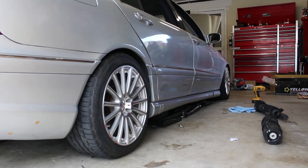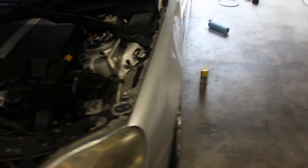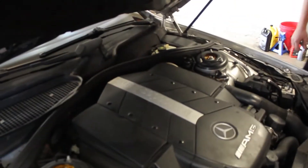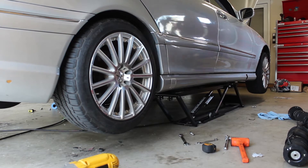Oh my god — okay, so we might be a little too low in the front. The rears look practically stock, but the front — you can't drive that. No, that needs to come up, needs a spacer. All right, so guess we have some work cut out for us. We should take measurements before I raise it back up. Drop the rear an inch, raise the front an inch and a half.